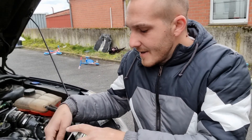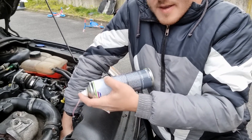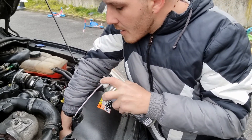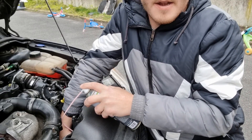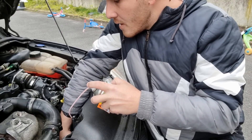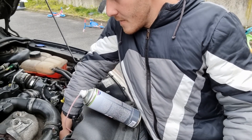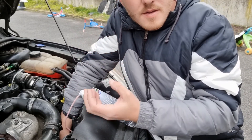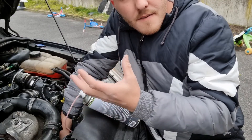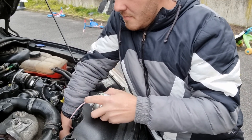I will do it again and show you. I need to do this just a little more because I have it inside. Move it down and spray, then wait, and again — spray and move it from all sides. Leave it like that because it needs to come down into the DPF. It needs to come down, and then you spray again. Like that.